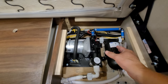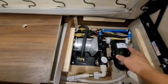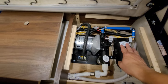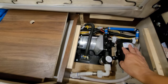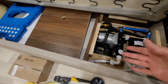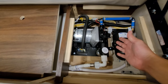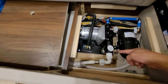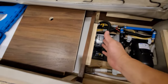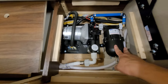There are many videos out there on the accumulator tank, but let me go over a couple of items why the accumulator tank will help in this RV especially, or RVs like this, especially if you have a Truma AquaGo water heater. I shifted the water pump to the left a little bit — it just takes four screws at the four corners — shifted it over. That gave me enough space to set the accumulator tank.